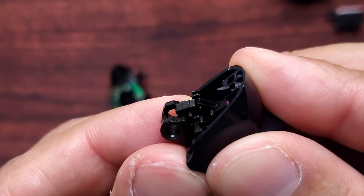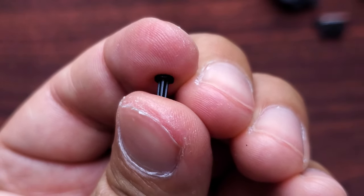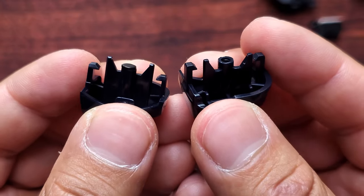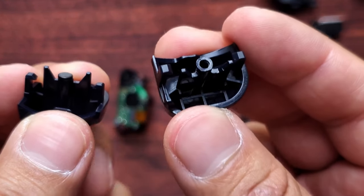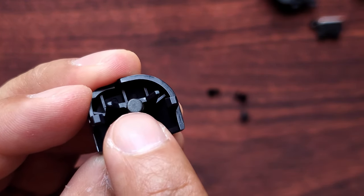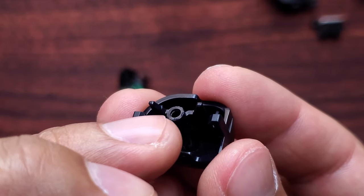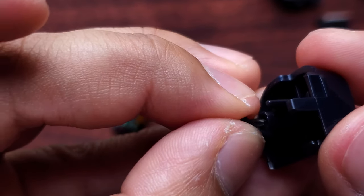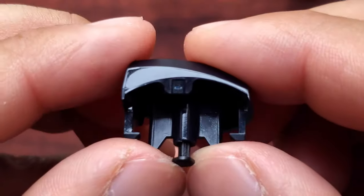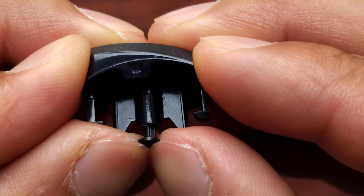The circular piece is going to go under your L1 and R1 buttons. Just so you can see how it's supposed to look — that hole is going to be covered. Grab your little round piece, insert it in that hole right there, and for this one you actually do have to push pretty hard so that it goes fully inside.